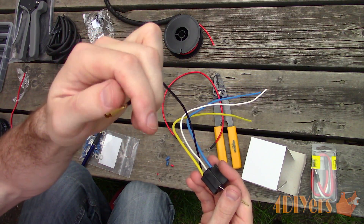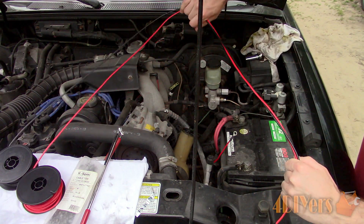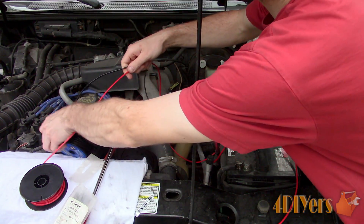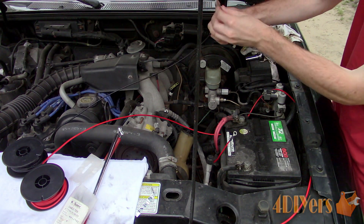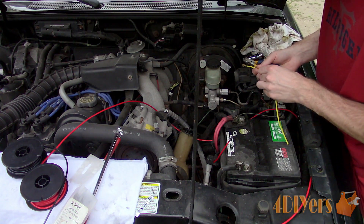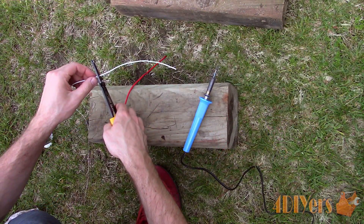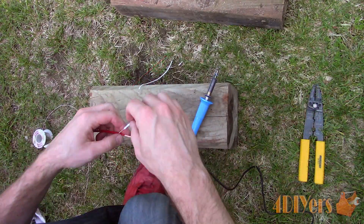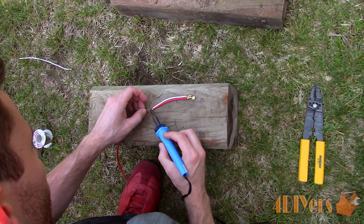The bracket for the relay and fuse box has been installed into place. Cut the wires to size which come from the light bar — the red or positive wire connects to the relay, and the black or ground connects to the factory ground location on the inner fender. Power is constant to the coil, so I am setting up a different circuit than what most use; the ground will be the switching wire for this setup. This keeps the power out of the cab and less wiring needs to be run inside the truck. A switch ground is used on some European vehicles and was also used on older North American vehicles. If you are wondering how to solder, I do have an ultimate guide — I'll include a link in the description below.